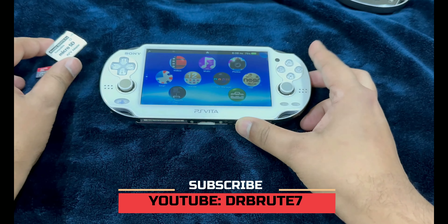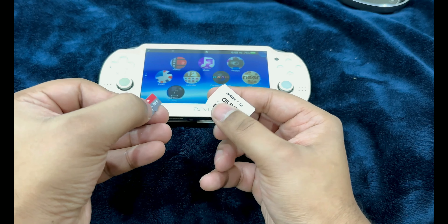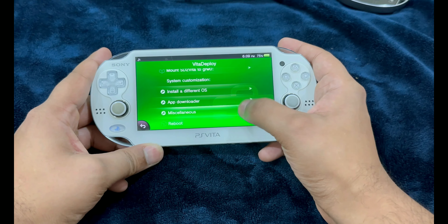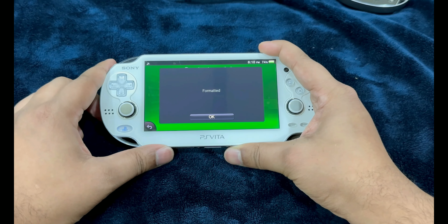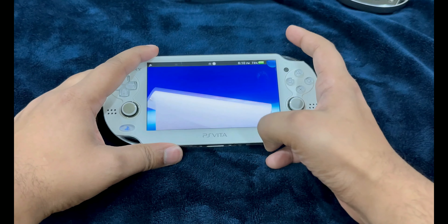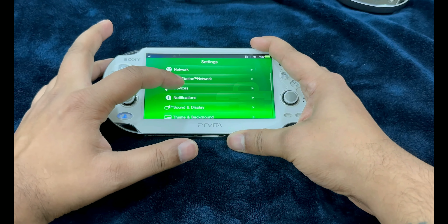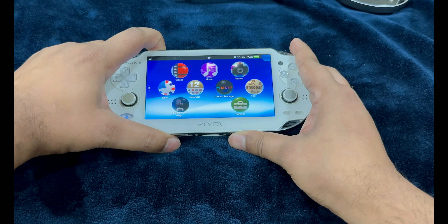After performing those steps, it's time to increase the storage capacity of the PlayStation Vita. Make sure you have an SD2Vita adapter and a micro SD card to put inside it — I'm using a SanDisk 128 gigabyte Ultra micro SD card. Insert the adapter into where the game card goes in. Start Vita Deploy, go into Miscellaneous, then Format Storage Device, select Format a Storage Device and select Format Target Storage. It may take a little bit and won't show anything on screen — do not panic, wait until you see the confirmation message, then hit OK. Restart the PlayStation Vita. Once it's back on, go into Settings, Devices, Storage Devices, check the box that says Use YAMT, then restart one more time.